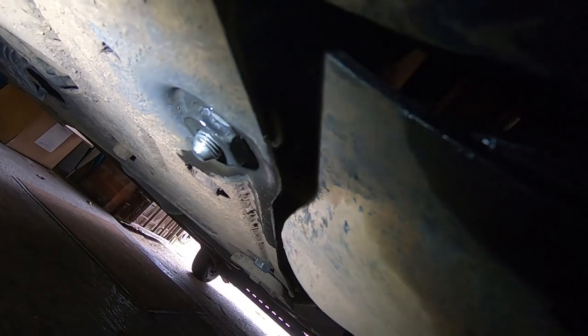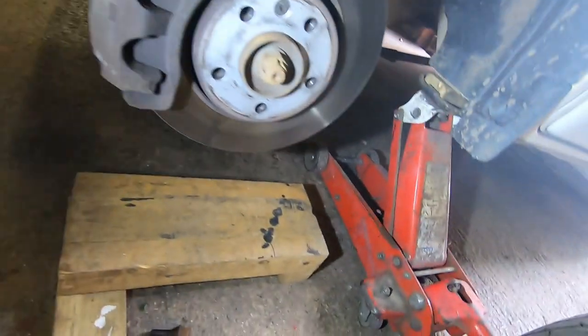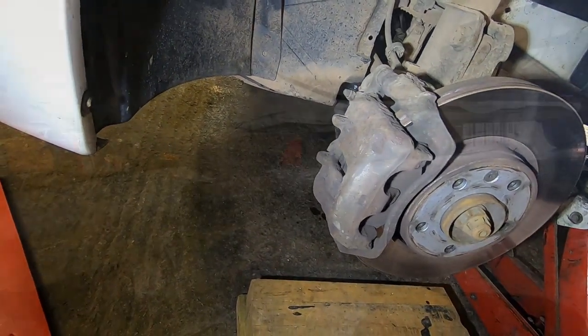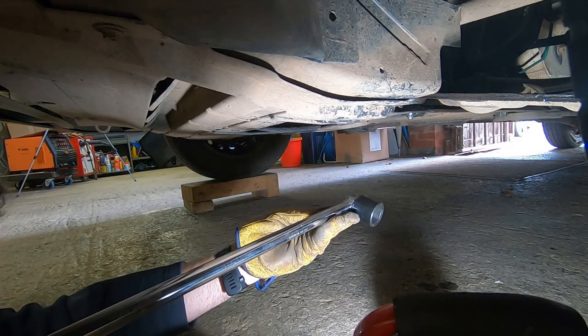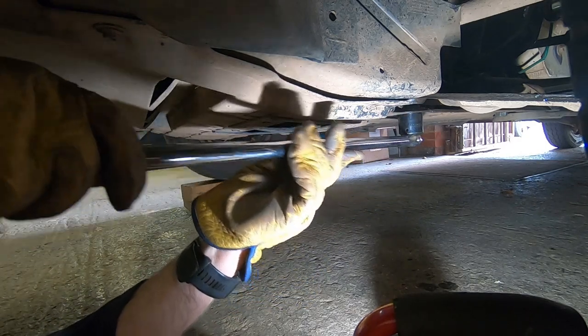So I was actually worried about pulling it off the axle stands. I was pulling so hard. So what I'm going to do is put this wheel back on the blocks, and then give it some what for. Right, so it's 30mm, we've got an impact socket on it and our trusty old Halfords, I don't know how long it says, 2 foot bar, I suppose. Let's see if we can do this.